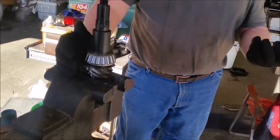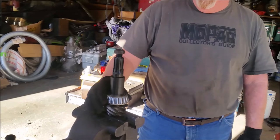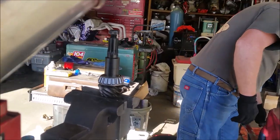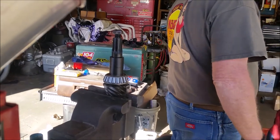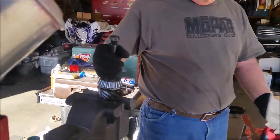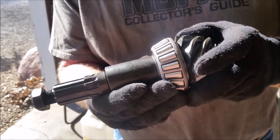Press the new bearing on. That's the inboard bearing on the pinion shaft — there'll be an outboard bearing up top. Then go the races into the case. We used the stock shims and left them in because that's generally related to the case dimensions. Look at those nice new pretty parts — looks good.